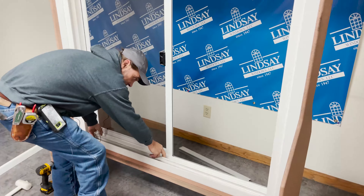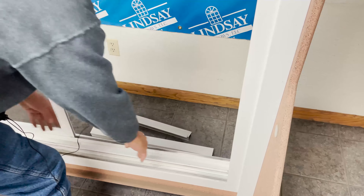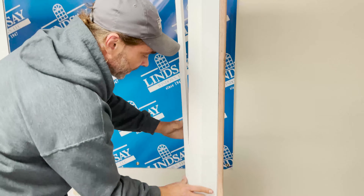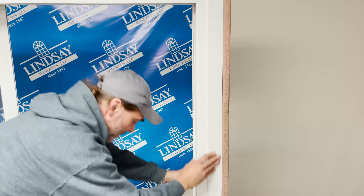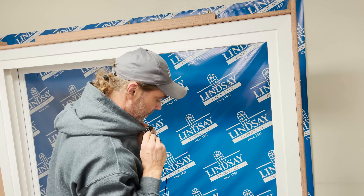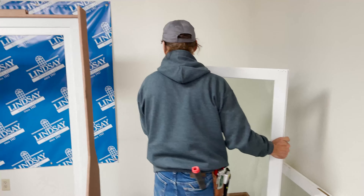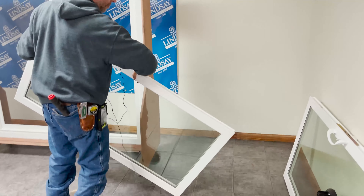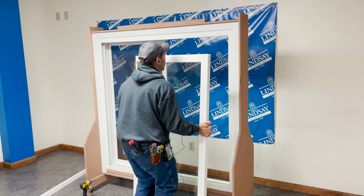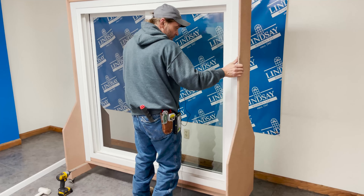Now you're going to have fillers in this door, and your filler pieces need to be moved to the other side — like so, snapping back in there and over to the other side. Now we'll grab this panel, and your panel has to flip over. It only has a reinforcement bar on one side, and that always has to go to the center. And it just slides back in there like we took it out — push the top in, set the bottom in, and we'll shove it all the way to that side.